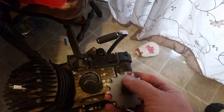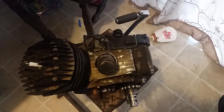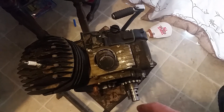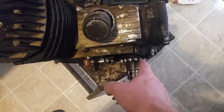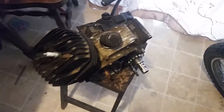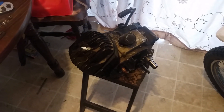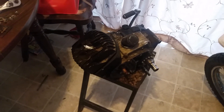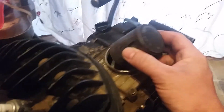It just has a big giant hole in the center and slides over the shaft. The downside is when that sprocket wears out, you better hope you can find one — kind of a poor design, should have been replaceable. But there again, it's only a 100, it's not like it's a 125 where people are going to spend big bucks on it. This motor had a seal leak and burnt up the piston — it's just toasted.